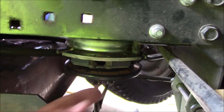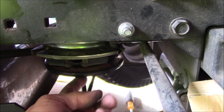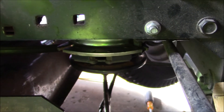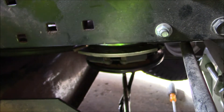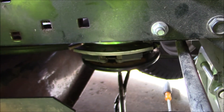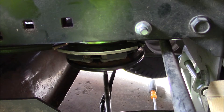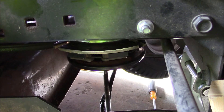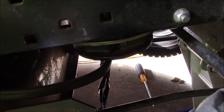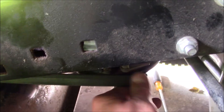I've got it up there, got this lined up with the notch in there, got the bolt in there, and now I'm going to go ahead and tighten it up with an impact. I know there should be some type of torque spec, but it will turn the motor over if you tighten it up, so I'm just going to use an impact. Next, I'm going to put the lower belt back on that I took off earlier so I could get the unit to drop down.